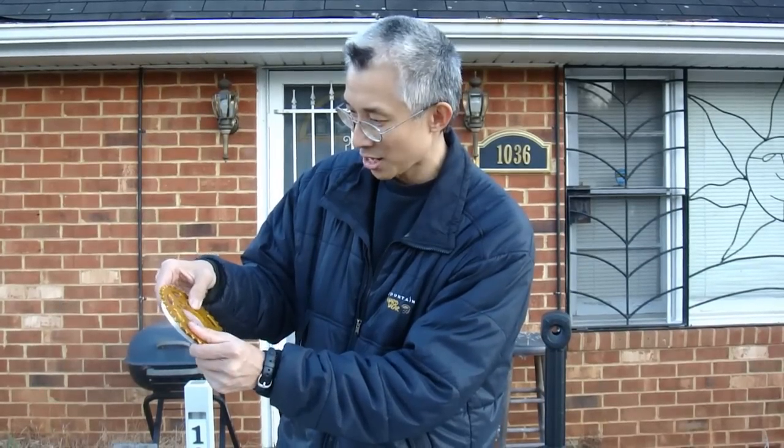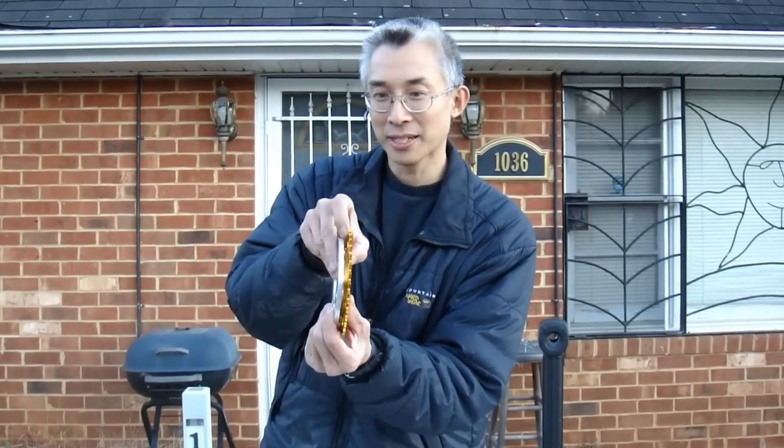Just trying to line the holes up there. You can see where it stands it off so it does give you some space for the chain. Now this is a 36-tooth gold sprocket we had just laying around the shop, so it's not really a fair comparison because it is quite a bit above the bolt circle diameter. But when you start getting small with the sprockets, that's when you want to use our new Top Hat sprocket adapter called the Sombrero.